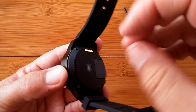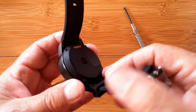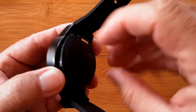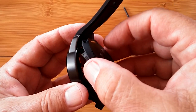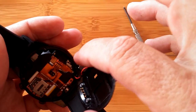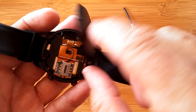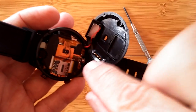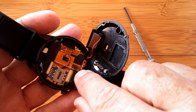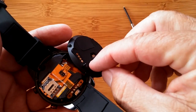This is a really interesting design. The original designs just had a motherboard, a screen, and a battery in there somehow. Now they've gotten the computer-aided design thing going and it's kind of 3D. I'm being careful because I've already been in here once and found out there's a connection to the back, so we can't remove the back cover completely. Here are the charging pins that charge on this side, go all the way through, and touch pins there. Sometimes when a watch doesn't boot up it might be because it's not getting power due to something wrong with this multi-point connection.